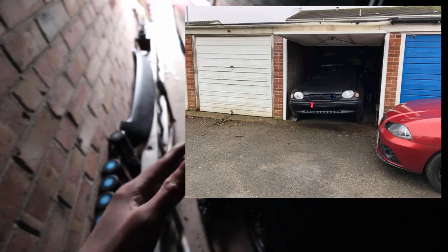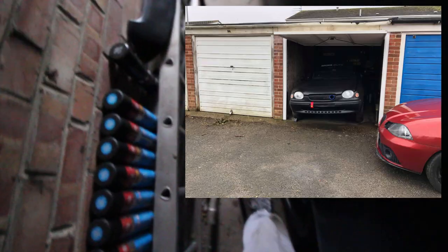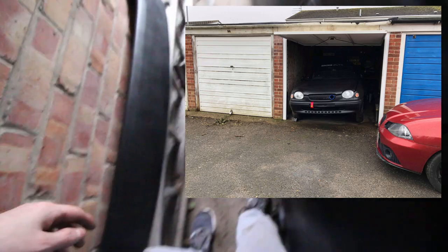So what I'm going to do now is jack it up inside the garage, because outside it's very windy and it's raining all the time, and in a bid to not get wet, I'm going to do it in here. I do have enough room, believe it or not. The camera makes it look a lot smaller than it is, it's basically as wide as me, more or less. So I'll jack it up in here, get it on axle stands. Obviously I'll only jack up one side on axle stands, but I'll do it quite high so it tilts it. Chock off the wheels at the front so it can't roll, even though the handbrake's up anyway, obviously,